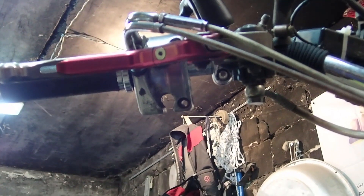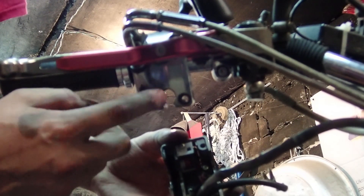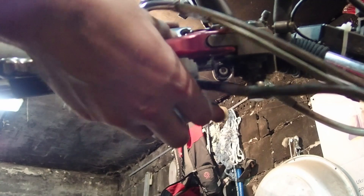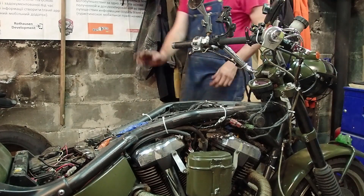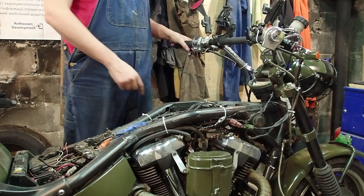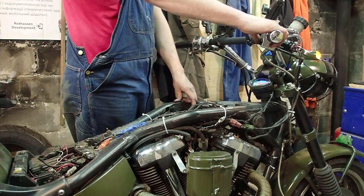To put this back together: your two wires for the brake come out the side while the rest of your bundle of wires comes out the middle. Be careful you're not pinching anything, otherwise you'll have issues. Once it's all back together, make sure you're in neutral — in neutral you don't have to worry about the clutch switch. If you're in gear it will not start unless you have your clutch pulled in and kickstand up. Turn the key on and let the fuel pump prime; once you hear it stop, you're ready.